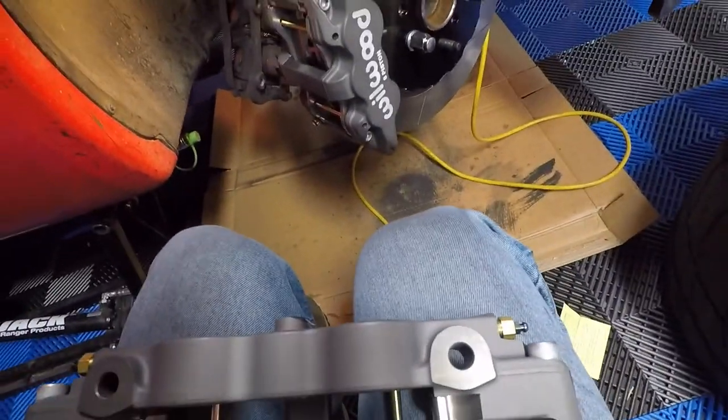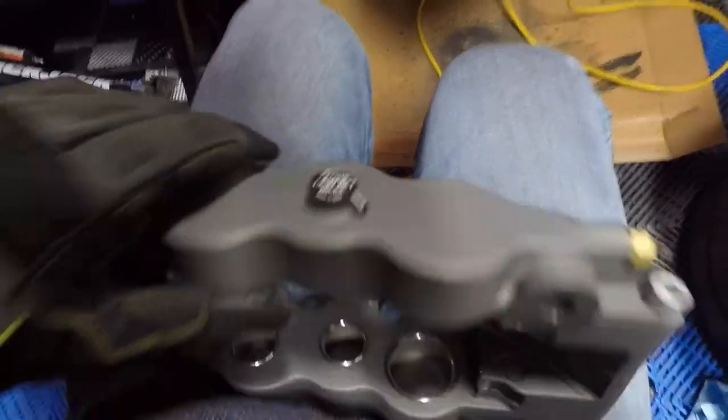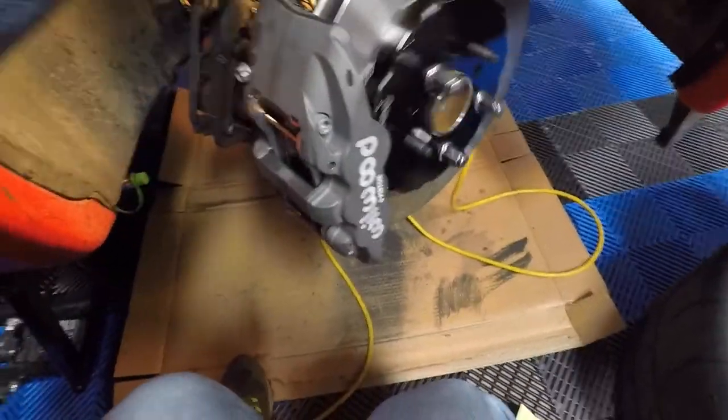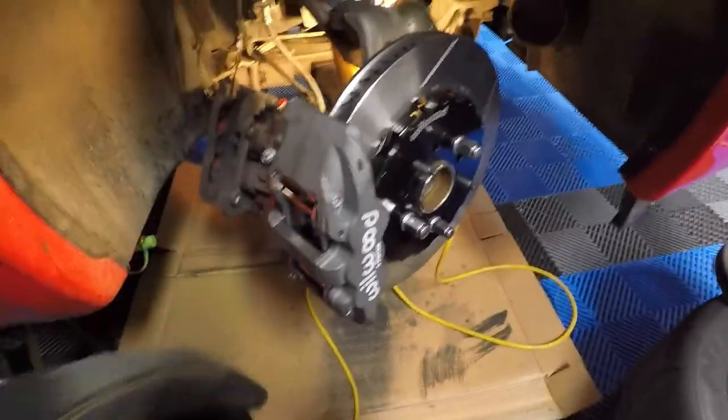So I was like, oh, well, that's got to be the problem. So I just lifted out this little tag where the new inlet's going to be in, let the air out of the system, pushed those pistons in, went back to two shims, and now it fits perfectly. Very little rubbing, if at all. There's zero. Look at that. Just very tiny rubbing there.